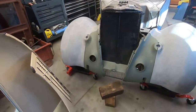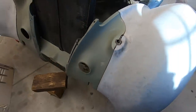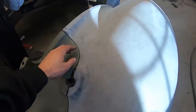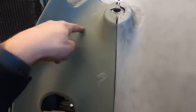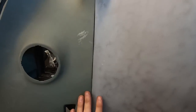And then I think, pretty sure we're just shaving these and welding this. I'm not gonna just weld the crack. I'm gonna cut this out so it's smooth. I'm probably gonna cut largely around it, so there's no lip at all, and it's nice and smooth. I'll make a panel that fits in here. It's gonna be a reverse because it comes down and up and in.